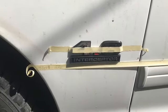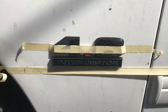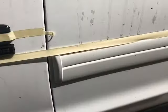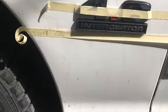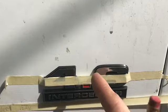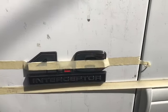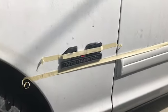I got some emblems today and I already have the emblem where I want it. This door molding was a bit wonky — someone put it on there a bit messed up, so you can see it kind of dipped down here. I just went further back with the tape, and I had a mark measured from 12 and 3 quarters, and from the back of the fender to the center of the emblem is four and three quarters. So I know I can do the other side and they're gonna match.